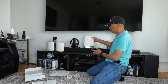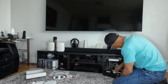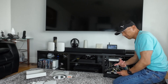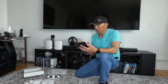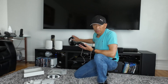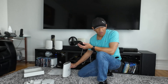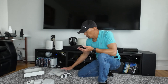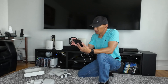Now I'm going to unplug the old router. If you're going to use the Wi-Fi router of your internet provider, make sure you connect it to LAN 1. So now I've disconnected my old Orbi router and I'm going to connect my new Wi-Fi 6 Orbi mesh router. When you set up the new router, the mesh router on your Orbi, go to your Orbi app.